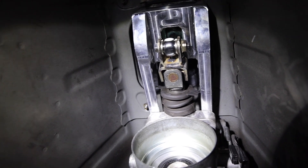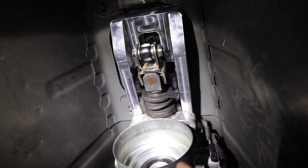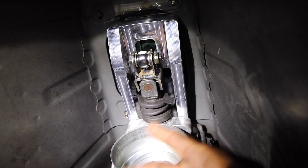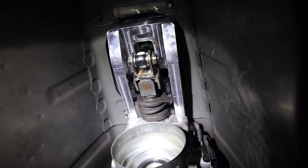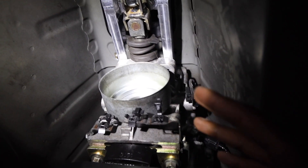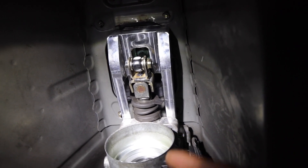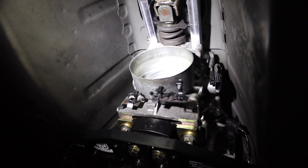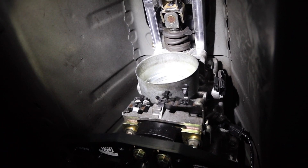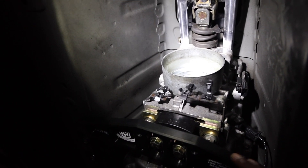The only thing I noticed is the shifter is kind of leaning to the side. I was wondering if maybe I go to the top and loosen those two bolts up there, maybe I can shift it over and that might straighten things up top. I'll double check now that this is fully bolted in. From looking under the car it looks like it's still a little bit to the side — it may just be where I tightened it. Kind of like a hood, if you don't tighten it in the right place at the right time something won't be aligned. It's worth the shot.